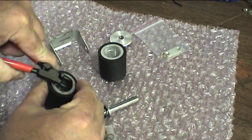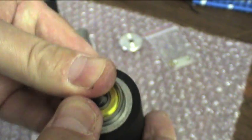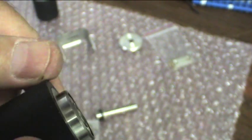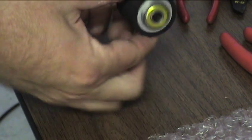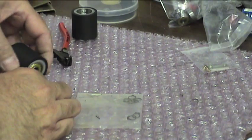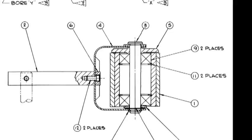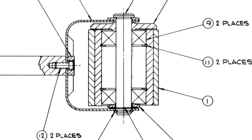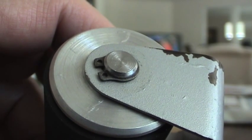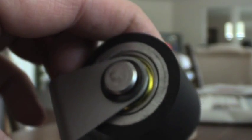Those clips are hard to get out, but you keep playing with them and you can finally get them out. Here's a bearing — we're going to put that into the new pinch roller. It's a tight fit, so I usually heat up the pinch roller in the sun and put the bearing in the freezer so there's a little difference in size. It goes in a little bit easier if I press down on it completely. Now I've got the two bearings in and we're ready to install it. These bearings used to be pretty expensive, but now with the skateboard craze you can get them pretty cheap. Here is the completed pinch roller with the various spacers, wavy washers, and clips.